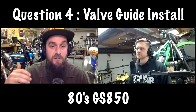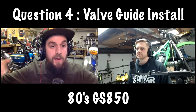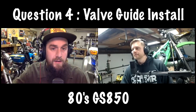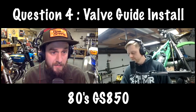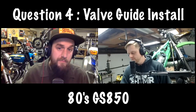And then I feel like you can use that information to then determine, okay, this is now above my head. I'm going to take it to a machine shop and have them do a nice little valve job, recut the seats and make it all match. I think it'd be very rare, I mean, you have 8 guides, it'd be very rare for all 8 to be perfect. I don't see that happening, but you never know.